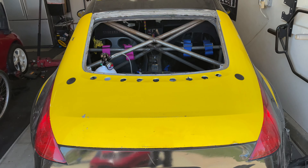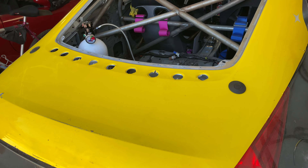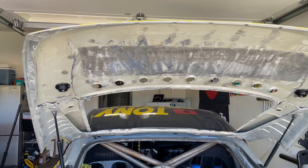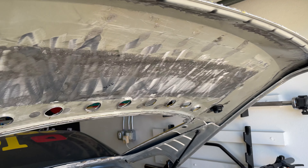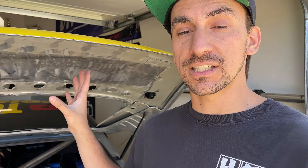For starters, we've got my old hatch with no glass in it at all. Did some cool dimple dies, and you may notice it's now held on with latches. With the hatch open, you can see I completely cut the back of the hatch out — there's normally like three or four layers of metal here. Between taking the glass out, cutting out all the sheet metal, and really getting it stripped down, we've actually cut the weight of this factory hatch more than in half. Completely stock, these things weigh close to 70 pounds; this now weighs less than 30 — I think it was like 28 or 29 pounds. A carbon or carbon Kevlar version would be lighter, but for stock sheet metal it's pretty good.